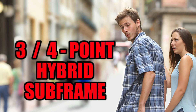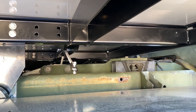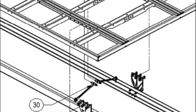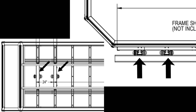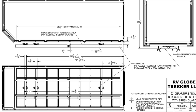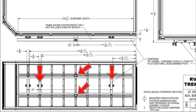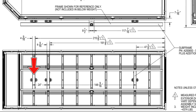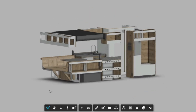The 3/4-point hybrid subframe: larger subframes from 14 up to 18 feet can accommodate a pass-through with a 3/4-point hybrid T-formation of subframe pivots. In this model, the 3-point system is used with the side pivots mounted forward, with heim joints installed as backup lateral movement restrictors, along with two aft crossmember pivots mounted in tandem. Even greater lengths of subframes are achieved with additional crossmember pivots. Beyond the 18-foot subframe length, the 4-point diamond-shaped pivot system is used with the addition of one rear crossmember pivot mounted in tandem with the aft-most pivot. The beauty of the Globetrekker design is the flexibility of our components, as they can be configured to meet your design requirements.